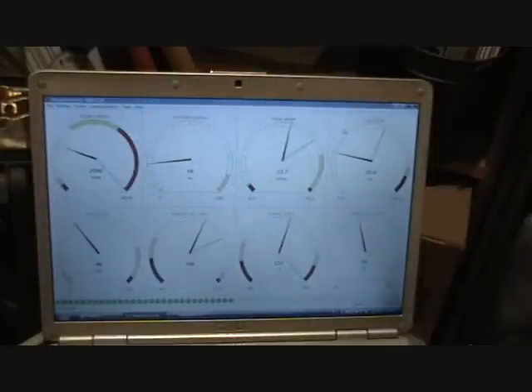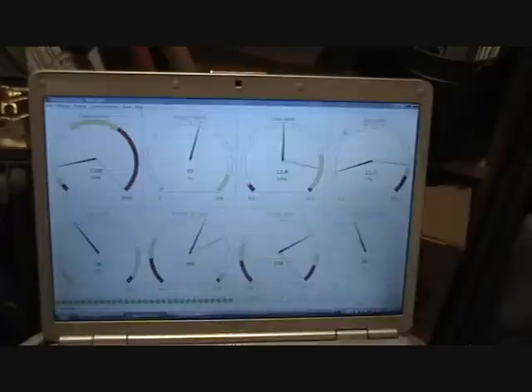What I'm going to show you here is a sweep of the engine RPM from 2000 to 7100. Here's your throttle position sensor voltage sweep. You can see the pulse width and the duty cycles changing with throttle and RPM. I can also mimic engine coolant temp so I can set my program for warm-up and where I want my enrichments. If you look at the very bottom of the screen you'll see green and red dots — that's your O2. In normal circumstances it will bounce between stoich, rich, and lean, and you'll have what they call an O2 cross count, which is how many times that O2 switches between stoichiometric value.